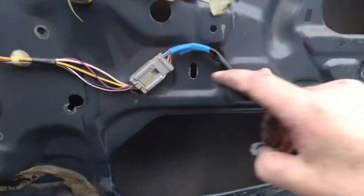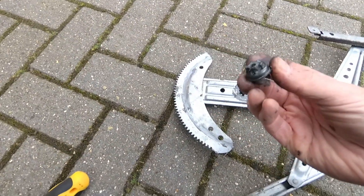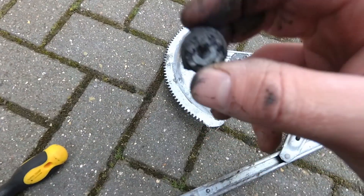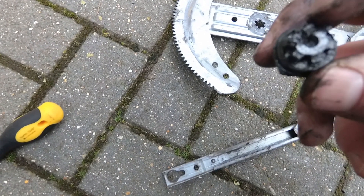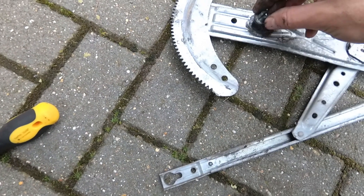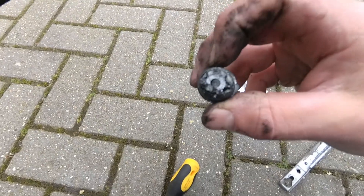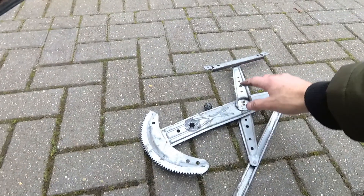After I removed this by undoing these two bolts and pulling it out, I actually found the item that's supposed to hold this in. At first I was really excited — yes, I'll be able to fix it! But no, because look how mashed up the teeth are right there. They've just folded in and some of them are smaller. I think what's happened — because the rubber has come off the inside here as well — the window got caught and jammed up on the rubber, and the motor basically ground the teeth off of this, which then meant the whole thing popped out. So yeah, needs a new part.